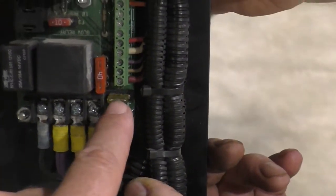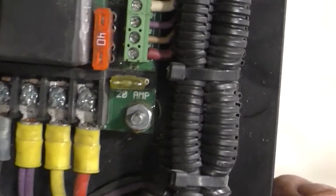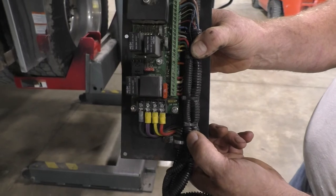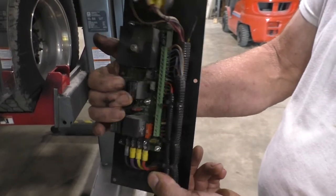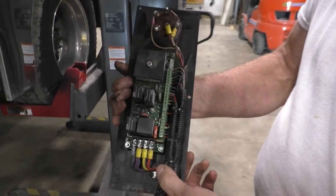If it does have power, that means your starter's good and you've got plenty of flow. The first thing to check is this little 20-amp blade fuse right there. A lot of times that'll be blown. If that's good, it's usually one of these relays — it's just a poor connection. Clean those pins and then it should start.